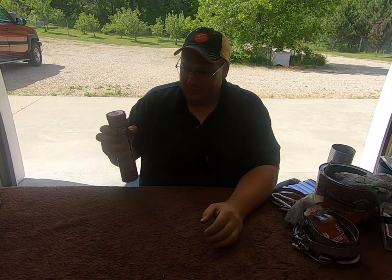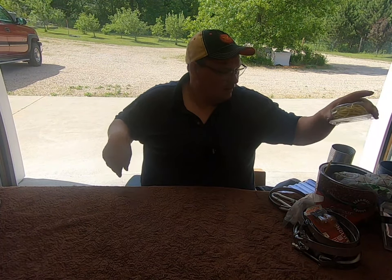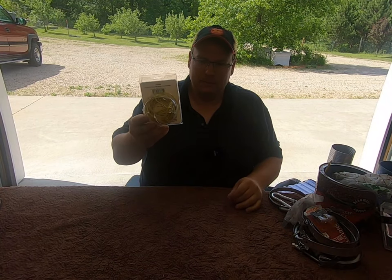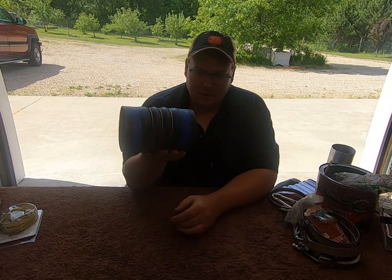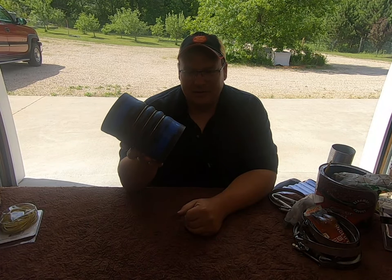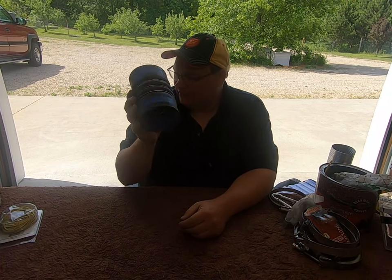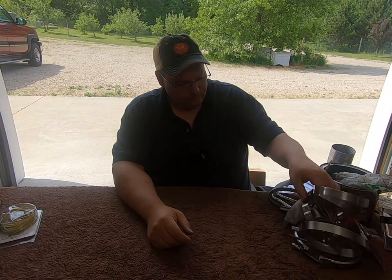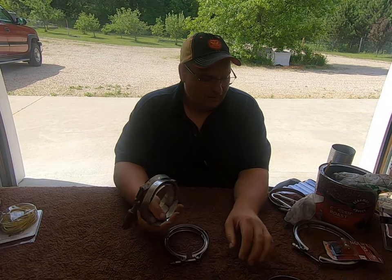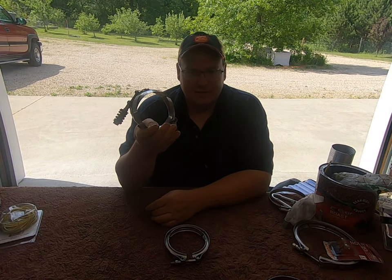A couple tubes of chassis grease — I also use that for fifth wheel grease. A couple sections of extra wiring for various things and different gauges. I carry one or two of these charge air hoses, and any time I replace mine I keep the old one as a spare in the truck, because if you blow one of those your truck is going to have a hard time getting down the road. Same goes for charge air clamps — any time I change them I keep the old ones, they'll fit the bill.